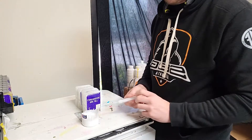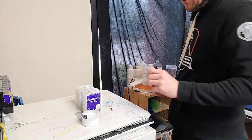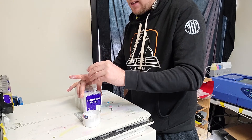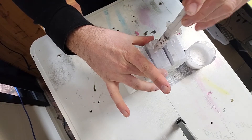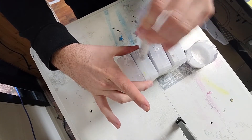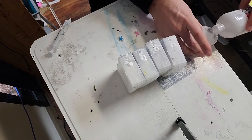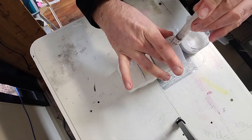I have a little bottle here that I pour some white ink into because my syringe will not reach the bottom of that. So I've got a little bowl here, and I have one for each color. We're going to suck it up just like so, stick it in this hole — the same hole we pulled the little rubber plug out of — and inject the ink into the cartridge. Since the cartridge is clear, you can see exactly how much ink is in them when you're done. They hold about three or four of these syringes, each one being 10 milliliters.